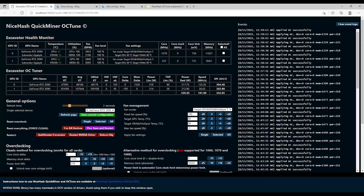Here's the aftermath after changing those thermal pads. This is a comparison between the stock card and my 3090 with the new thermal pads. It's running at 125 mega hash at basically the same temperatures as the stock card, but the stock card is only doing 55 hash right now — which is terrible — because the power limit is set to 215 and reduced quite a bit to get proper temperatures. It makes a significant difference: about 20 to 30 degrees less in temperature. No more thermal throttling — 125 mega hash, which is crazy.